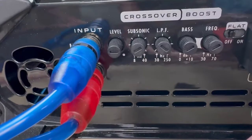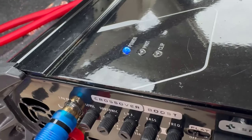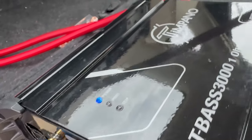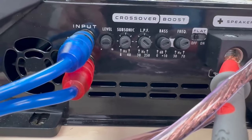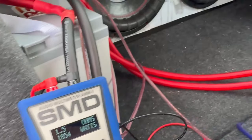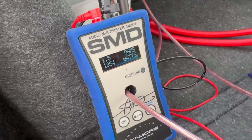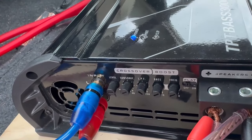As you can see, I set it to just below clipping with the 20 to 60 Hz frequency going, and it did not clip when setting these gains. It's set pretty low — I have it pushing about 1800 watts through. Don't worry, I'm going to get a new alternator which will bump up this number a lot, but you want clean power.